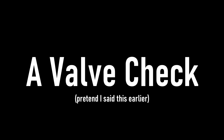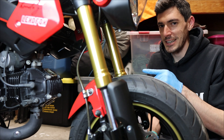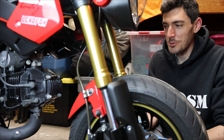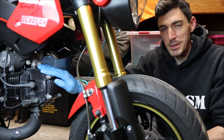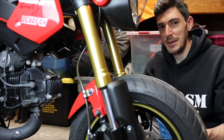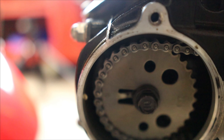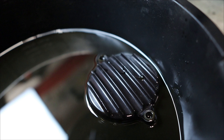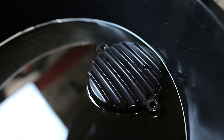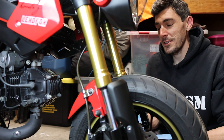While I let the oil do its thing, let's do another maintenance item — a valve check. Let me immediately amend that: if you're doing the valve check you want to make sure the engine is cold. Rest assured it is now cold — I've allowed it to cool down in the time it took me to get the camera set up, making sure everything's at top dead center with the markings and that the cam gear is aligned, dropping the cam gear cover in oil to make sure it's lubricated.